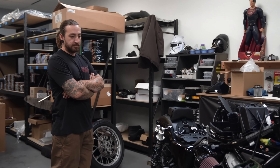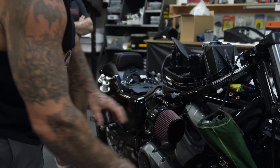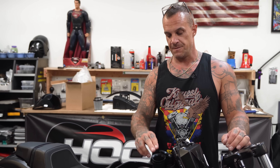Is this thing really better, sucking out in the old dirty Arizona air? Probably is better airflow, getting some from outside. Got a dent in the filter — that's not good. Did I do that? These are just long — I don't really know exactly how this works, but I think the longer runners would make a little more torque. So I'd like to try them all. We're gonna get Sportster S velocity stacks, which are different part numbers, and Panamerica velocity stacks. Then we're gonna try and get Trask Performance to dyno-tune this with all the different ones and see what kind of power difference it makes — because word is they can tune Nightsters.